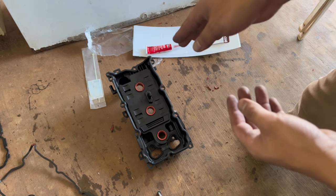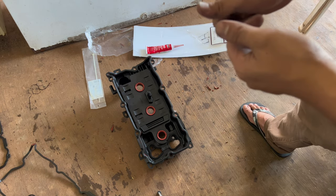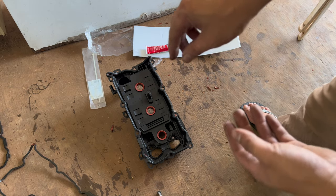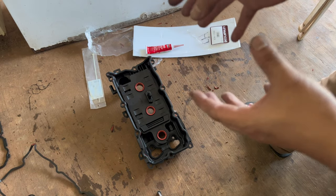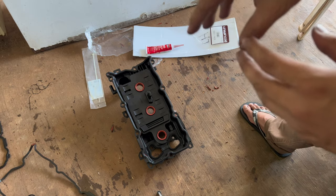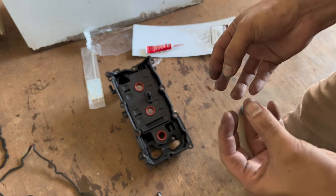Be sure to have everything plugged in, battery up and running again, and then we're going to start it up and see if anything's acting up or weird. You can watch if there's any leaks — if you forgot to plug up coolant lines or whatever. See if you did a good job. If it starts smoking, or if some crazy codes come up, or your dashboard gets crazy, observe it. Watch the RPM — see if it levels out below 1,000 RPMs. RPMs are good right there. There's no lights besides the tire light and a seatbelt reminder. It's not shaking, not having a rough idle — it's looking good. I already checked before I filmed this, so none of the things in the engine are leaking. I triple-checked all the lines if they're plugged in.